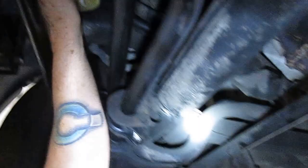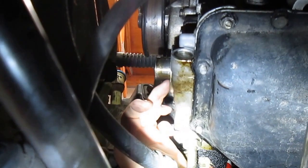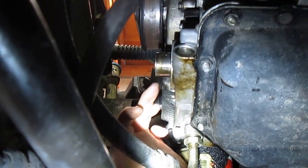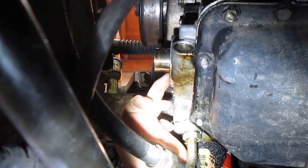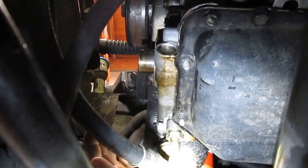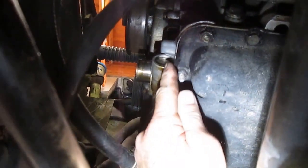Here's where the balancer goes on the crankshaft, right down here. The keyway is recessed inside this housing and the seal goes right here at the end. Since the keyway is recessed inside there, they didn't pay attention for whatever reason and just forced the pulley on, damaging it.